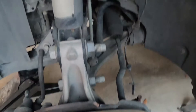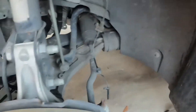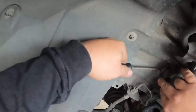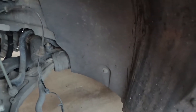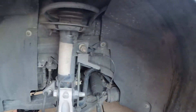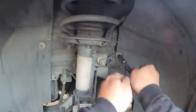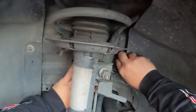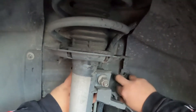People I've seen had issues with the sensors. Let me just readjust the camera a bit here so you guys can see it better. What I found is it's easy to take off this whole entire plastic bracket. To do that, we're going to take our big screwdriver, go in around here, and pop off this little plastic rivet. Once we get that off, that just pops right off. Then we take our 10 millimeter — you might have to use a ratchet, but I could easily take this off by hand. Pull the splash guard back, and now this bracket's here.